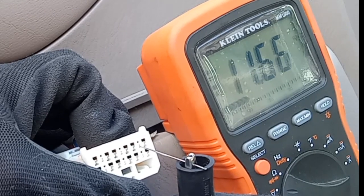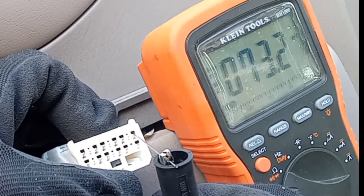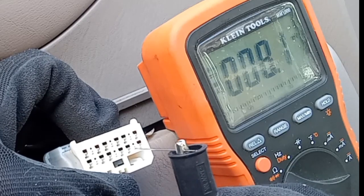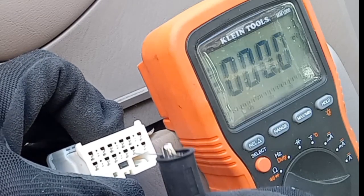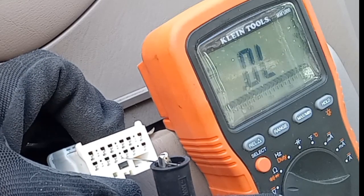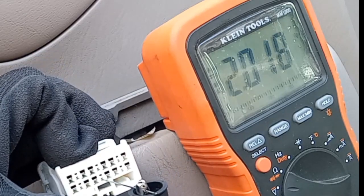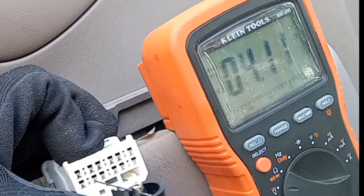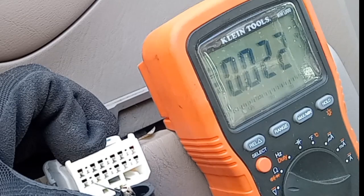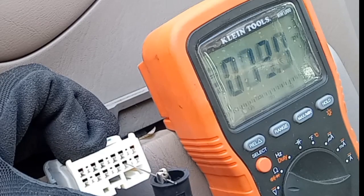In this pin we have over 11 volts. If you don't find any voltage when you're checking all the pins, then the problem will lie somewhere else within that circuit and will require more testing on that side of the circuit. This one reads over 12 volts. This smaller pin reads over 10 volts. Now we've concluded that we are receiving voltage from multiple pins on this wire harness. If you've reached this point and you have good grounds and good power sources, then most likely your master window switch regulator has failed and needs to be replaced.